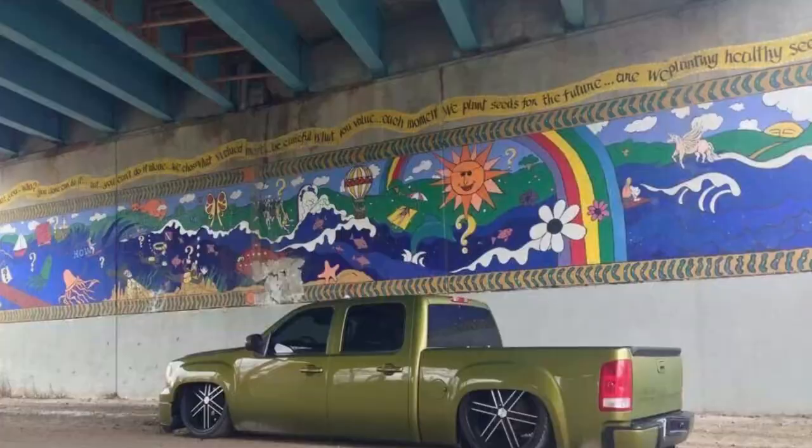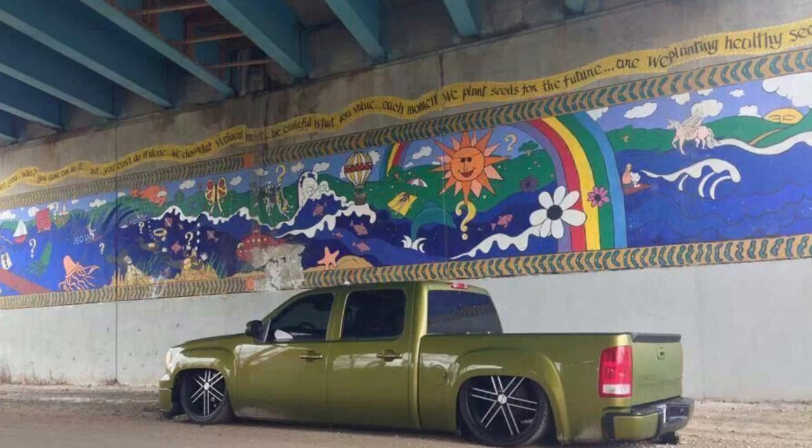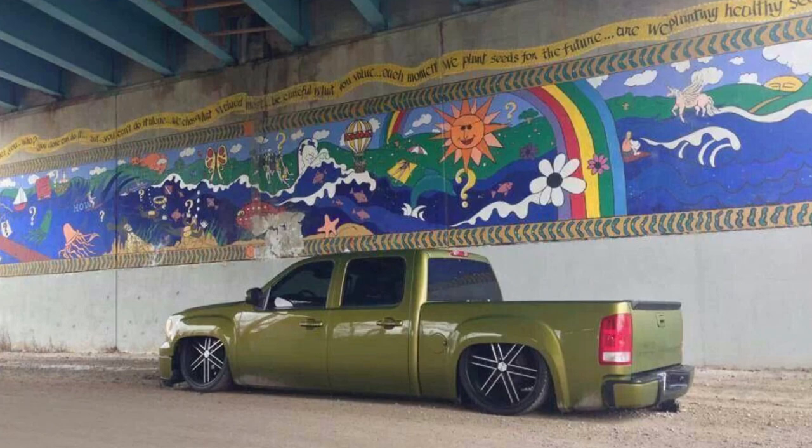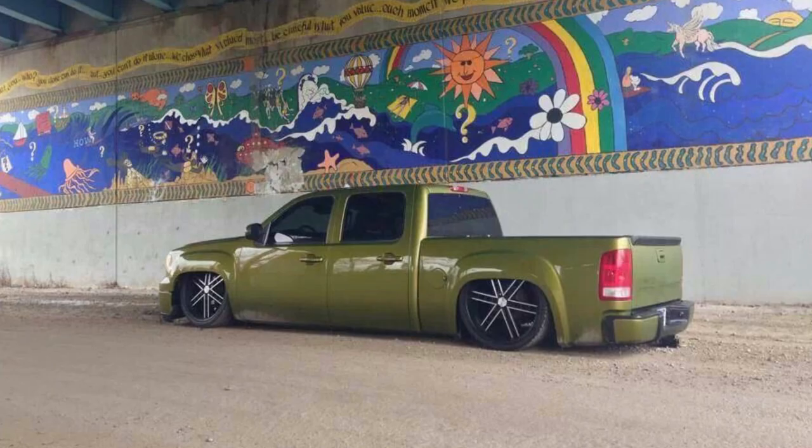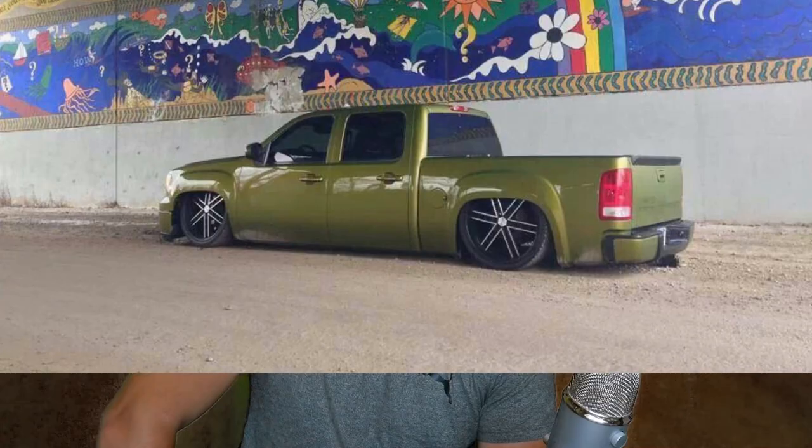Switch 5, I chose to make it control the back suspension. Now, I know you may be wondering, why bags? This car is not a lowrider. Well, in general, Rivited is kind of a low car. Low cars are great for track racing, but what do you do when you want to drive home when there are massive potholes and speed bumps? Bags enable you to control your suspension height and protect your car's undercarriage. This whole upgrade will cost you about $1,000.